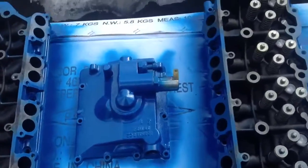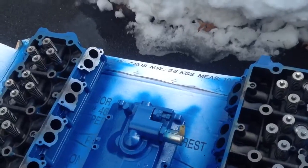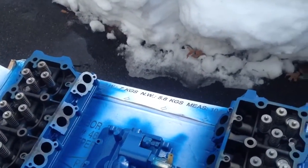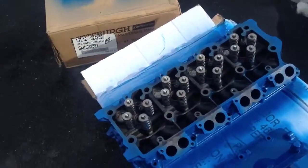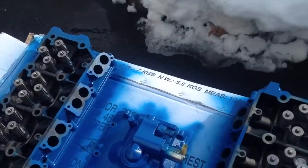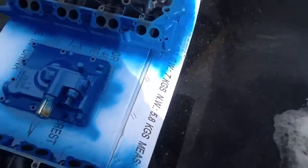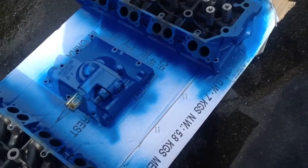Got the pump cover. Another issue I noticed: the yellow O-ring. Previously, whoever owned this vehicle before and did the high pressure oil pump put the yellow O-ring on top and it kept burning — that's the problem. It's supposed to be the black D-ring on the International; it goes on top. I've since corrected that problem.